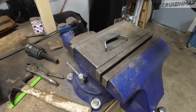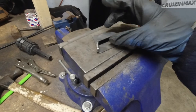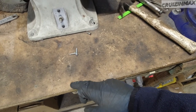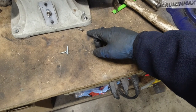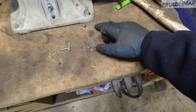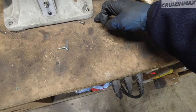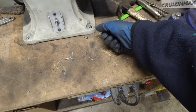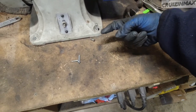Working on the parking brake rear assembly. I've been shopping around and I just can't find the part. What I need to do is connect the parking brake line — there's one going to each wheel. One line connects both wheels, going to the front or rear of the transmission just above the drive shaft. It's a tight fit with the drive shaft in it. This cable goes around and back to the other wheel, and right in front there's an adjustable bolt that goes through the handbrake handle. Something needs to connect the cable and that adjuster with a little hook at the end.